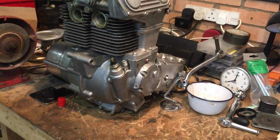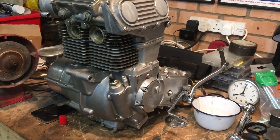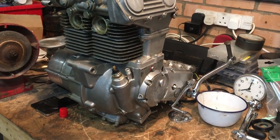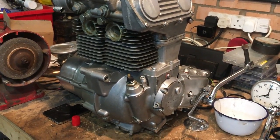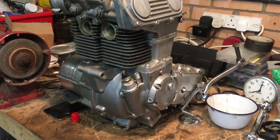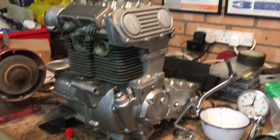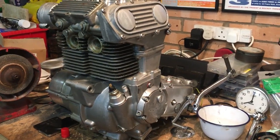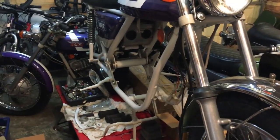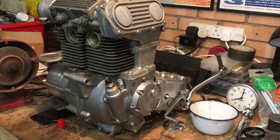And then tomorrow we're going to turn our attention to the E35S Fury motor, which is just about complete with respect to its first fit. Tomorrow we're going to strip the lot down into parts, and then we'll prepare the parts for the final assembly, mainly cleaning up, ensuring all the tolerances are correct, etc., on the final build. And we'll adopt the same strategy as with the A70 Lightning, is that once the bottom end is together, then we'll put that into the waiting rolling chassis and build the rest up from there, as it's on the lift. That makes it quite a bit easier. So there we go, that's the plan for this weekend.